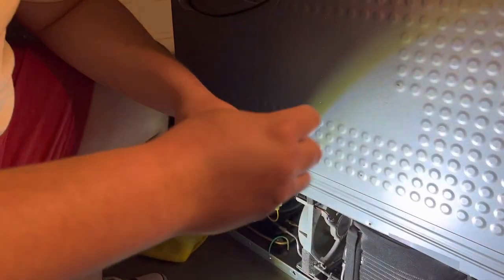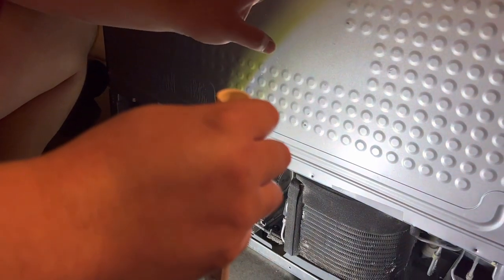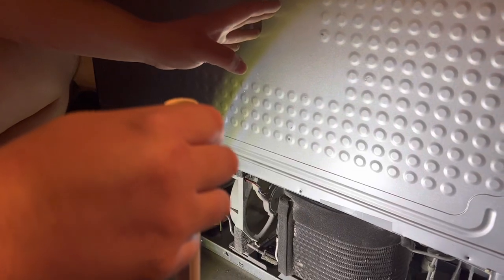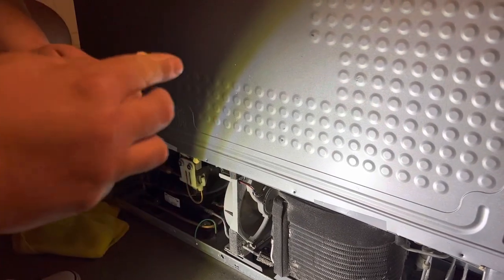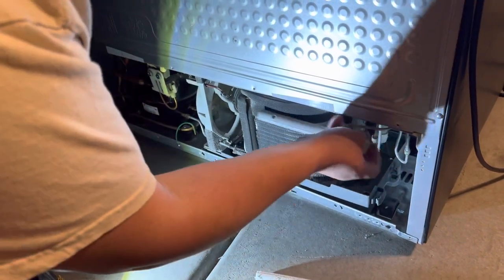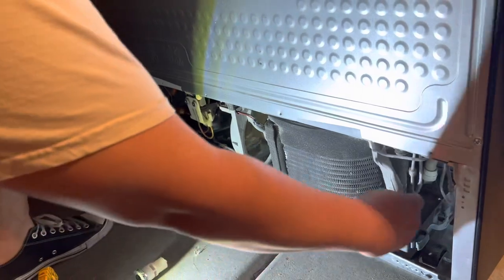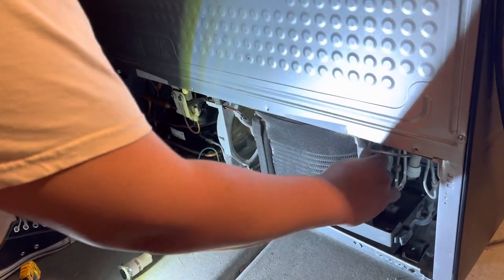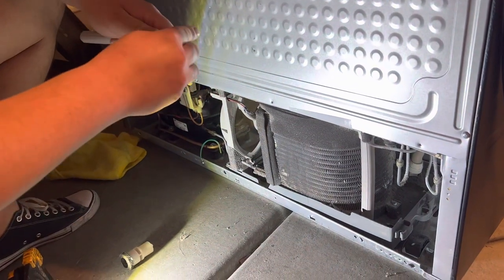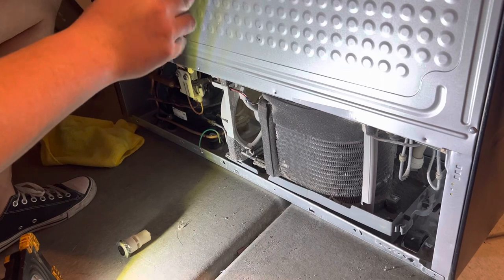These are the drain lines. One of these drain lines is for your ice maker on the Samsung. The other one's for the fresh food section evaporator. And the other one's for the freezer evaporator. And both of these were right in here. So you put them back on. Put these things back on. And this is gonna save a lot of problems.